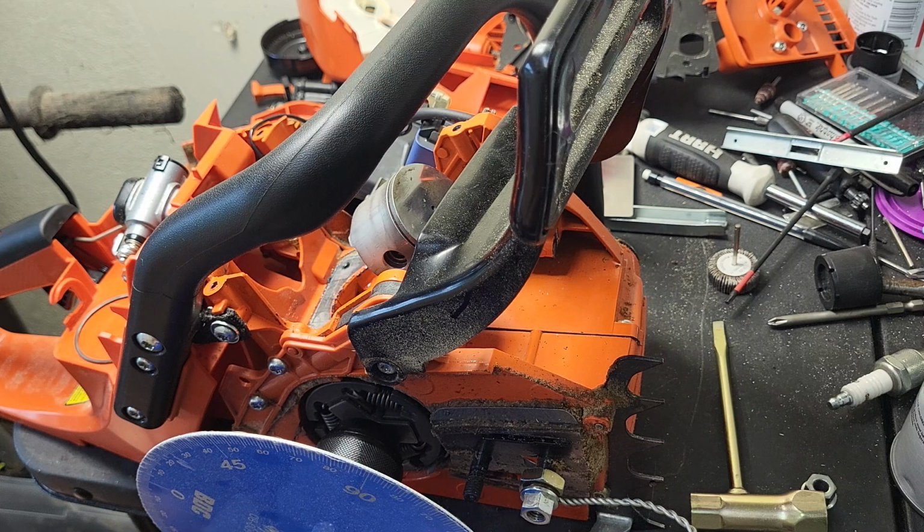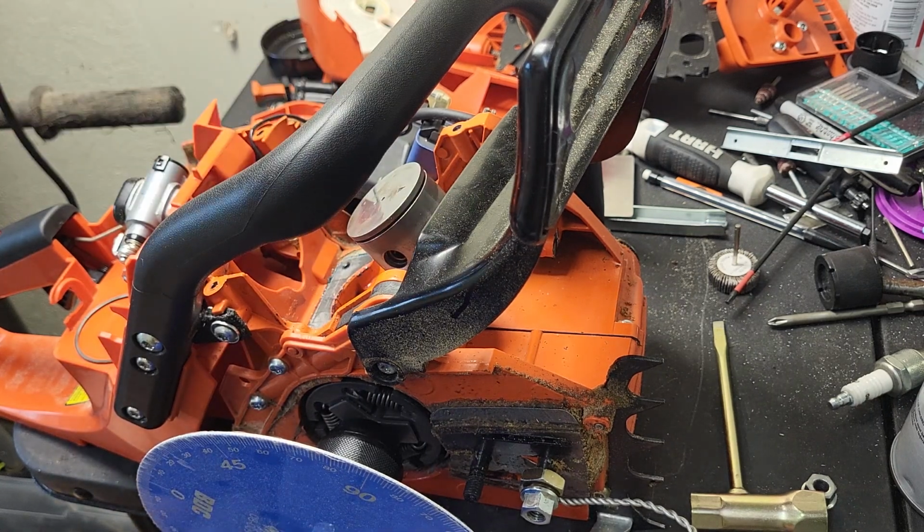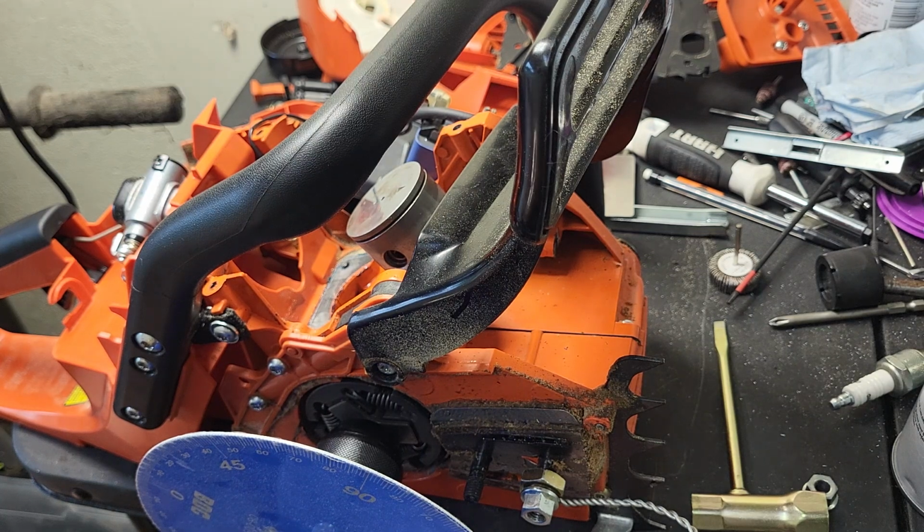And if this doesn't really work out for whatever reason, then probably just run up the exhaust a couple degrees and see where that puts me. It's 78.5 plus 40, it's 118.5. That's what was suggested to me. Let's time the transfers 40 degrees after the intake. That's what I'm going to go for.